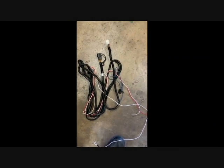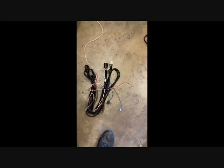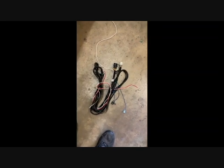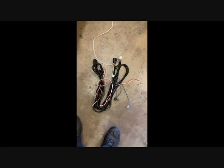What's all this spaghetti? This is a Jeep Wrangler 2004, so we definitely don't need this long white wire with a loop — that's for GM trucks only. What that does is it sends power whenever you press a function on the controller. When the solenoid engages, it also sends power out on this white wire, which tells the GM truck to not turn on the alternators. There's a relay involved, there's a service bulletin for it on the 2016, 2017, and possibly 2018 models. It was really associated with dual 200 amp alternators but I've heard of it with just about all GMs.